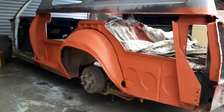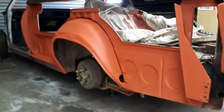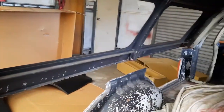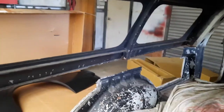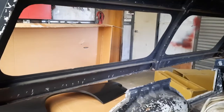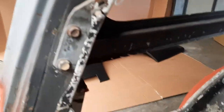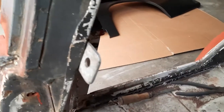I've cut this whole inner panel off, up to the pillars. I will have to cut windows in the pillars to be able to do the plug welds. But I'll get everything else welded in and get this panel put back in before I do any of that — try and keep the structure as much as possible.